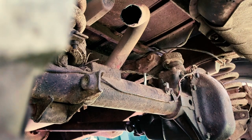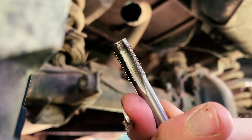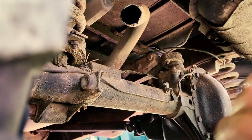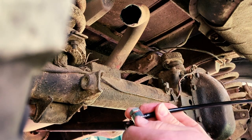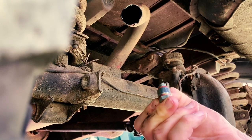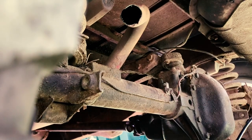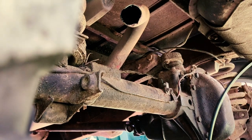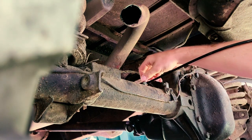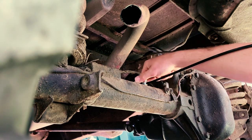Look at that - it's all the way through now. You can see it's not too bad, probably just a bit of dirt over time, but up in the thread and really good to have that cleared out. Here's the new breather banjo bolt - comes with the clamp-down copper washers as you can see. That'll be good, nice and fresh. This will go in here in the new thread - let's just check that works. Yes, look at that - fresh, lovely!